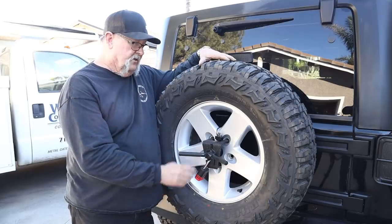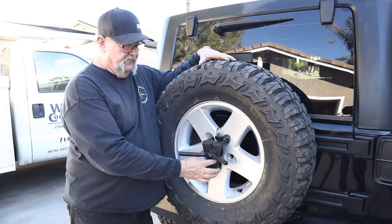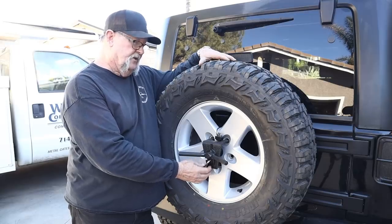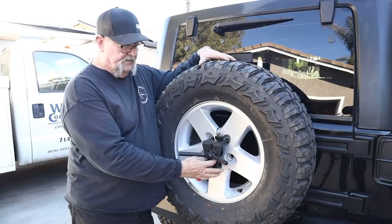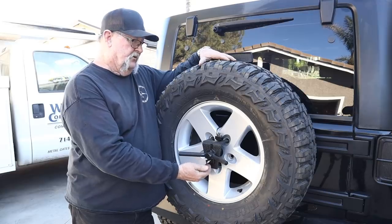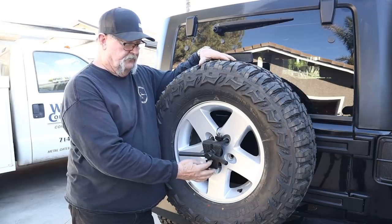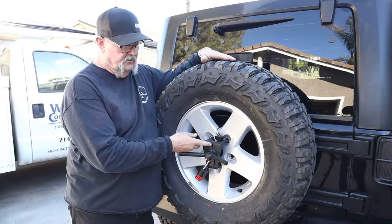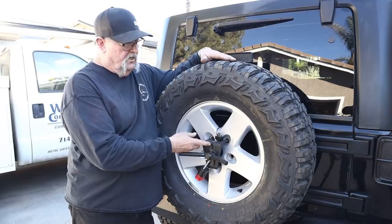I could literally take my finger and bend that bar out, which would bypass the lock. So I upgraded it — on the very bottom I put a one-inch, or inch-and-a-quarter wide by eighth-inch thick flat bar stock, welded that to a washer, and drilled through it so the lock mounts there. It's going to be much more difficult for anybody to try to steal this tire now.